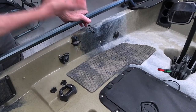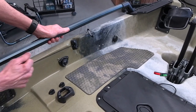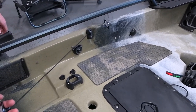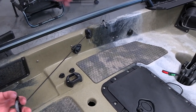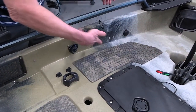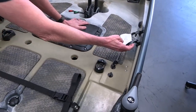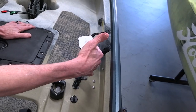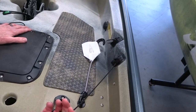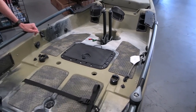All the cockpit controls have cleats and they're labeled. For the skeg, to retract it you pull parallel along the cockpit wall, and to deploy it you pull out at a 90-degree angle to release it from the alligator teeth — there's a bungee that's bringing it in. On the other side is the rudder. Pull it straight back to retract — that's what you'd do for transportation or storage — and then pull it out at a 90-degree angle to deploy it back in the water.